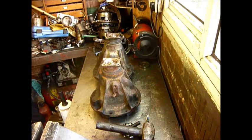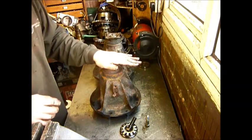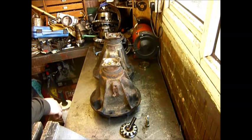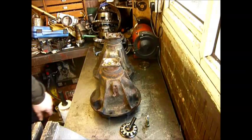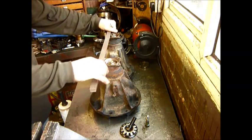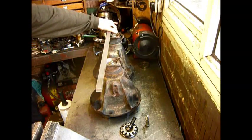Hopefully you can see now that we've got two cases — long nose and short nose — and you will see straight away that the difference in height is significant, hence why it's called a short nose diff. You can measure that in some simple way and see that it is considerably shorter.